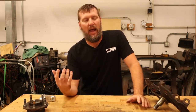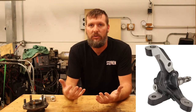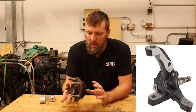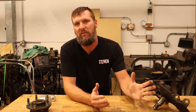Now we'll get into spindles that have the upper ball joint already configured on them. The first one that comes to mind is the Mustang II spindle, used in seventies Mustangs and common among hot rodders today. There are several companies that make aftermarket versions with corrected geometry or drop spindles. That one does have separate bearings — a separate hub similar to a trailer or truck setup with inner and outer bearings. I'm not sure if it has a tone wheel, and the geometry I've heard is not great for a double wishbone race setup.